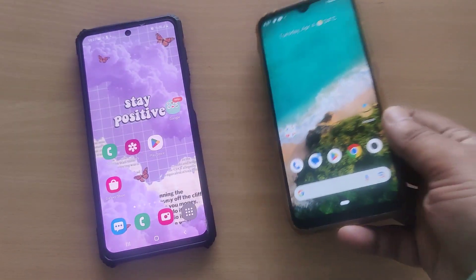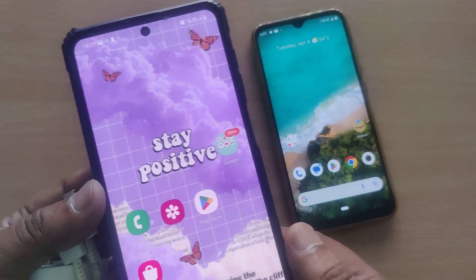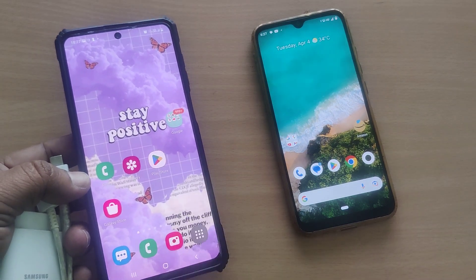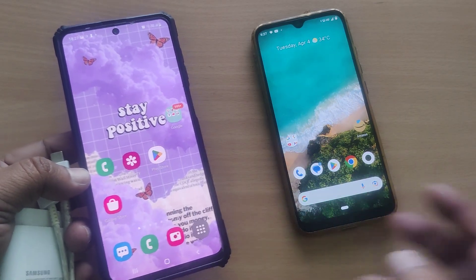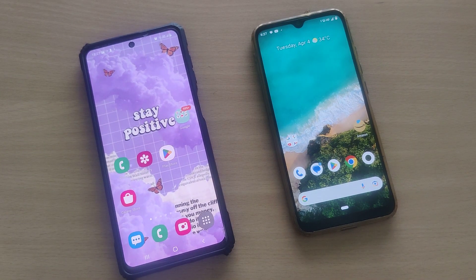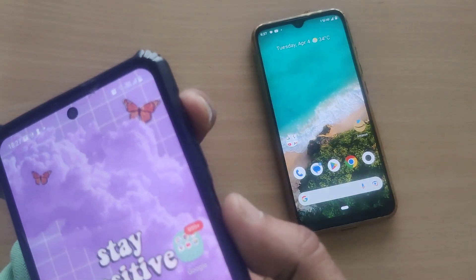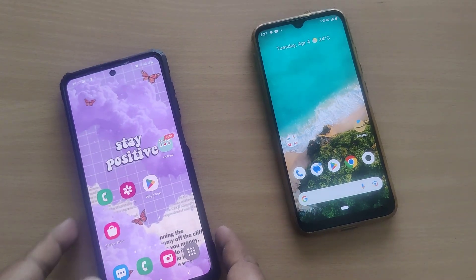But since the inception of the M series on Samsung, M series mobiles support reverse charging. Since reverse charging was introduced in M series mobiles like the M51, M31, M52, M53, and so on, those mobiles do not enter recovery mode by simply pressing volume up and power button simultaneously.